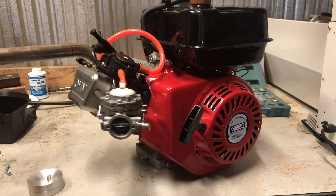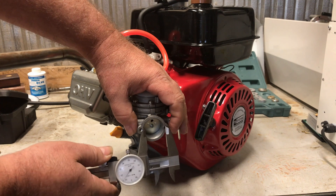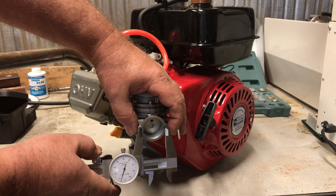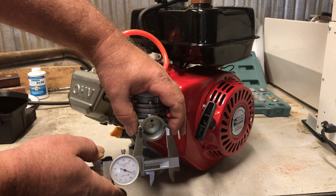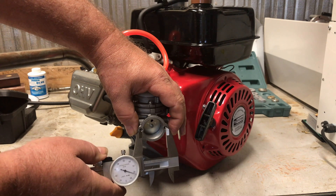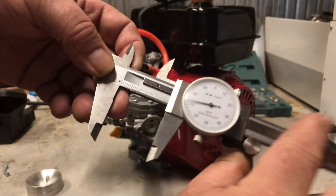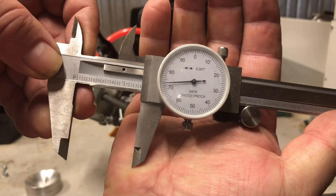On the EC-308, it's got a two-and-a-half inch OD for your air filter to bolt to, and a 913 thousandths ID. The bolt spacing here is 1 inch 375 thousandths. I had originally thought I was going to use this because I had measured another Tilly clone that we got, and it measured up at 1 inch 375 right about there.